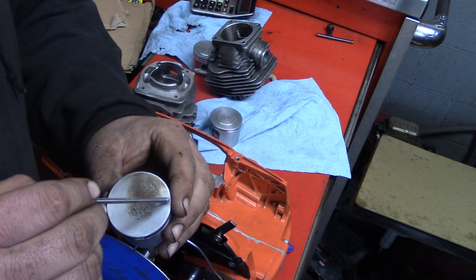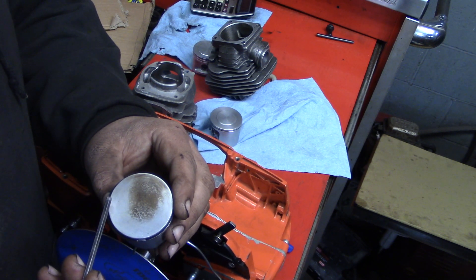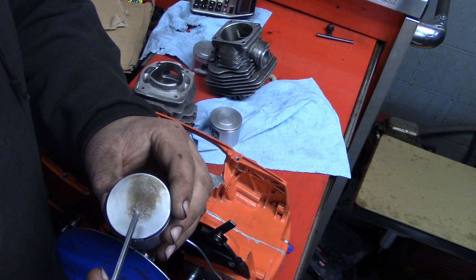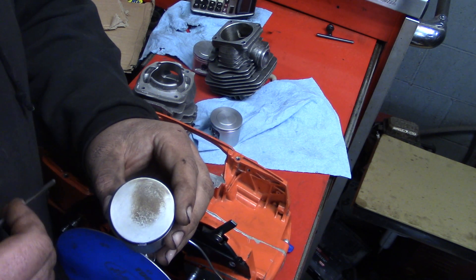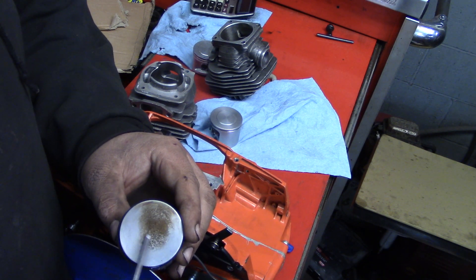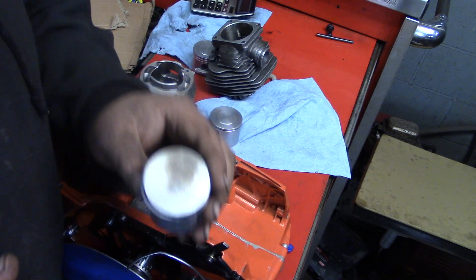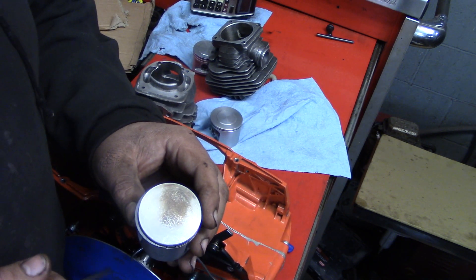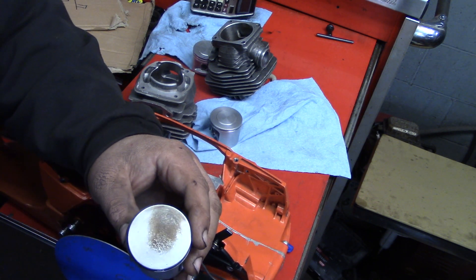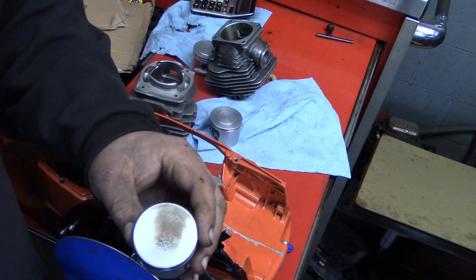The better your wash pattern is, the more volatile the explosion will be. If you only get your wash pattern out partway, that air and fuel won't cover the combustion area well — you'll lose some out your exhaust and have a weak power stroke, therefore low power on your saw. The more transfer velocity you have, the more you can push it in so when the piston comes up, it fires hard and you have a good, powerful saw. There's a lot more to it — I'll get into exhaust port shape, intake shape in another video.